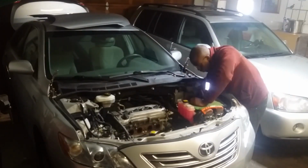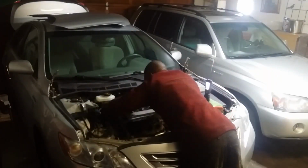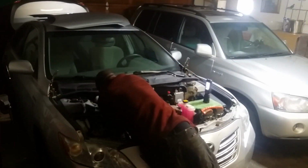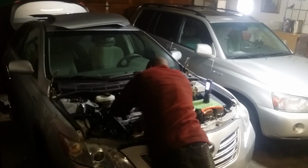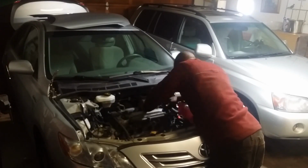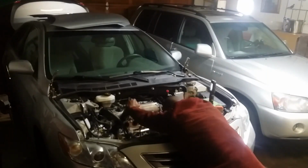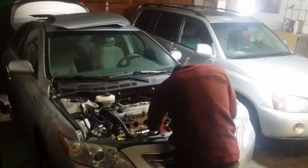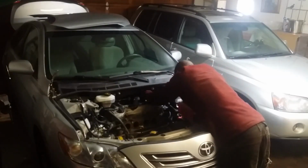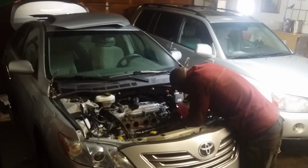Another thing we always see the internet insist on is the usage of heavier weight oil instead of what the manufacturer recommends. I know that even on this channel we've had comments like that on some of the F-150 videos. The truth is that it can be rather unwise to deviate from the recommended oil type on most modern engines. A couple years ago, I owned a Chevy Silverado 2500 with a 6-liter V8 under the hood. With the truck having about 260,000 miles on it, the oil pressure was understandably a little low, but after adding a quart of Lucas oil during an oil change, the pressure shot up to within specification.